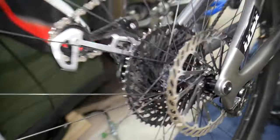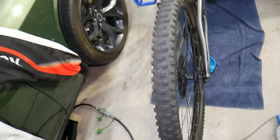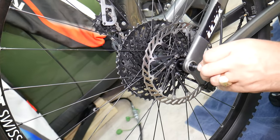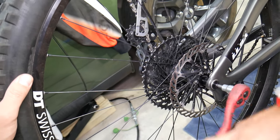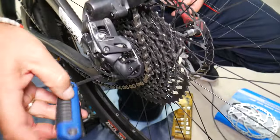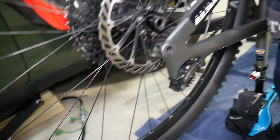We have the clutch here on the derailleur — we're going to extend it and press here so it stands, and then we'll be able to pull the wheel out. We need an Allen wrench to remove the axle — in our case it's a 5mm, but yours may differ. You may have a quick release. It's important to remove your rear wheel. We'll hold it with another wrench as needed and take it off, then pull out the axle through the chain.